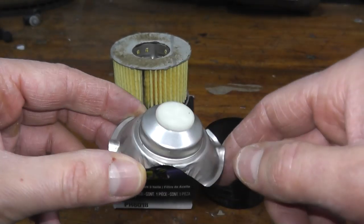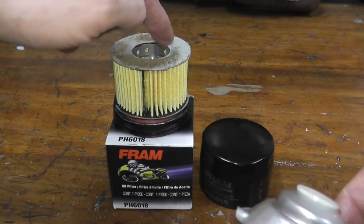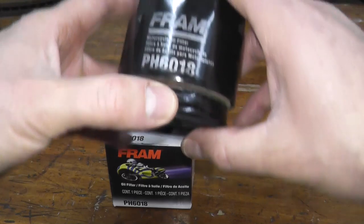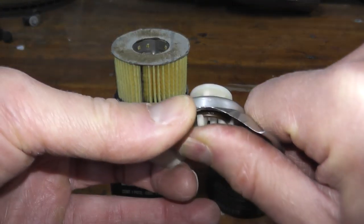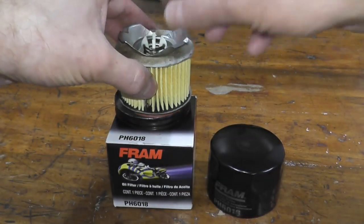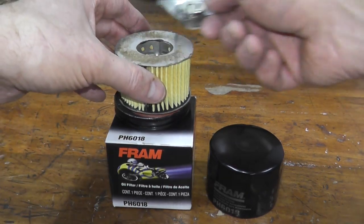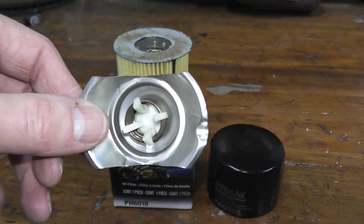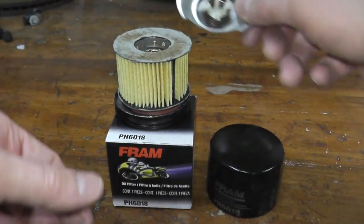This right here is just a stamped piece of steel — really two components: the stamped piece of steel and a bypass valve. In some filters the bypass valve is built into the housing. The stamped piece of steel just keeps all the components nice and tight inside the filter. In some filters you'll find a coil spring, which you'll see in a few days. The bypass valve has two functions: number one, under very cold conditions this valve opens up and allows unfiltered oil into the engine — typically opening around 9 to 12 psi. Secondly, if the media is completely clogged and can no longer filter the oil, this valve opens up so unfiltered oil can get back into the engine.